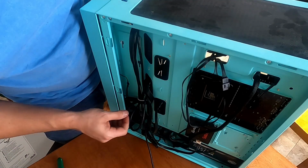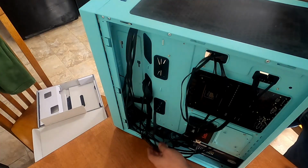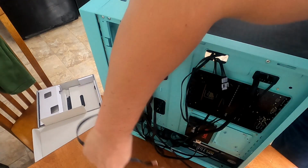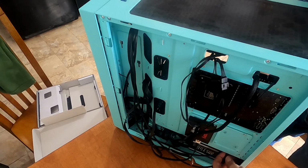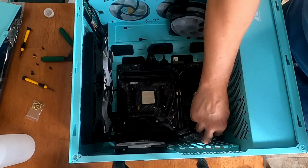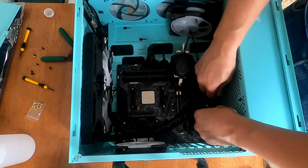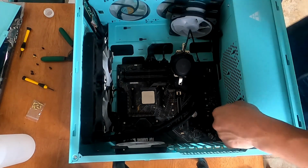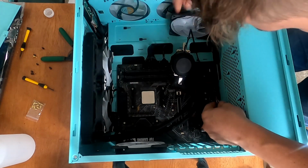USB 3.0 installed. Okay, now we just need to move the front panel connector over to the other side of the motherboard because it's in a different place on this motherboard. So we're gonna come over with these USB cables over to this side, stick those through, stick my AAFP plugs. Okay, so down here we've got two USB plugs and we've got the front panel connectors, which is going to go into the AAFP header, which of course is your analog audio and front panel connectors.